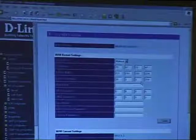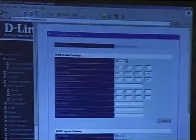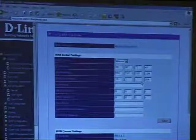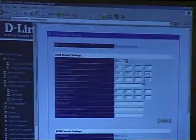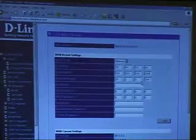And if you don't know what that means, if you have a device commonly sold as a router, it's really just a NAT device. But if you've got anything that calls itself a wireless router or home network router or anything like that, you will not get an externally routable IP address. This has to go directly into your DSL modem or your cable modem, and sometimes you have to flip those into something called bridge mode for this to work. So keep that in mind. This is a really bad device to buy if you can't get more than one externally routable IP address. So check with your provider, cable modem, or DSL or whoever before you do.